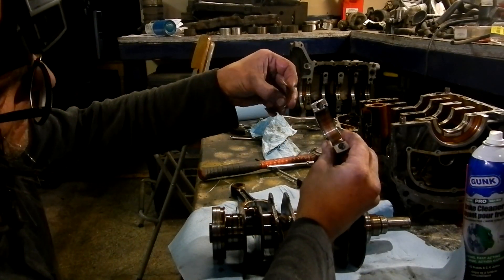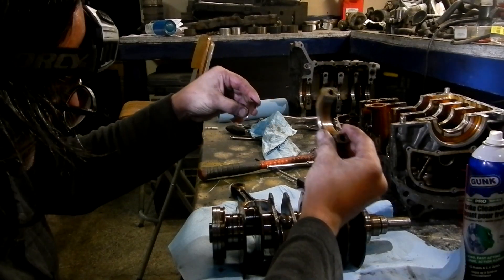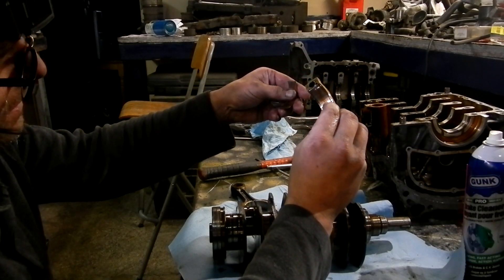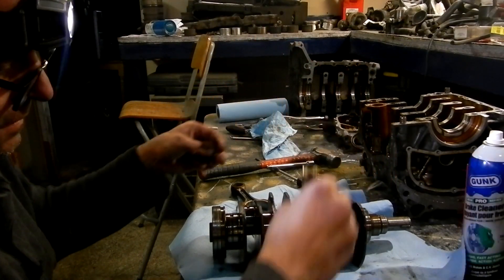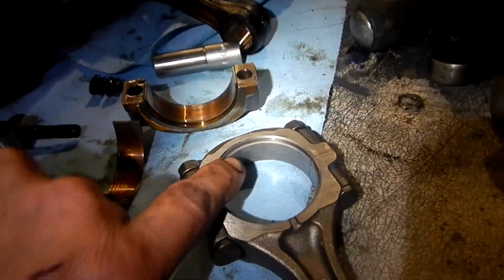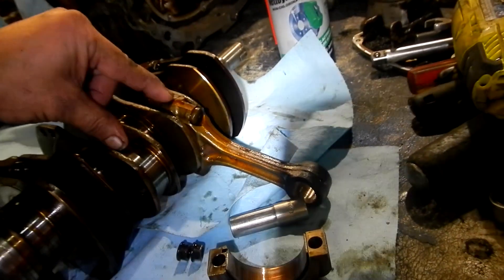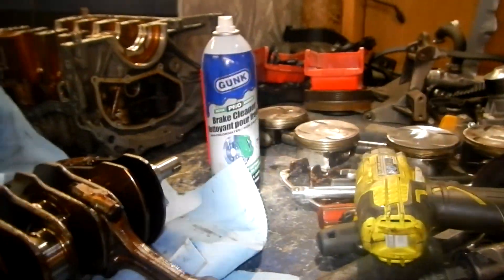You can see the discoloring here — this engine has not failed yet. It was loose enough to make a noise, so it's probably not too late to save it. I'm surprised there isn't more damage. You can feel it here but there's not much. Compare this good rod to the damaged one — look at the discoloration. Strangely, the two in the center are the worst ones; I didn't expect that. The starvation was pretty much everywhere, though even this one isn't bad.